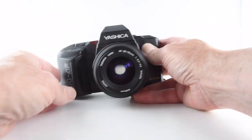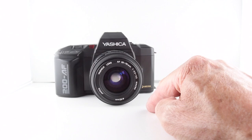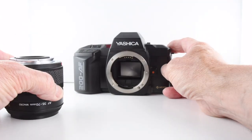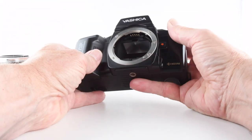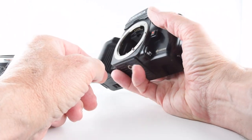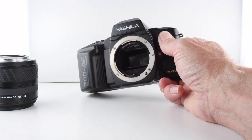Looking at the front, you can see the Yashica 35–70mm f/3.5–4.5 lens, which has a very useful little macro function — I found that incredibly useful. To take the lens off we simply press the release button and rotate. You can see the contacts on the lens. On the same side as the lens release we have the option to select autofocus or manual focus. The autofocus, as expected of cameras of this age, is not slow but not super fast — certainly very usable.